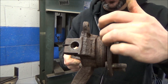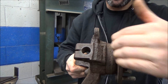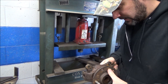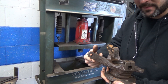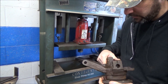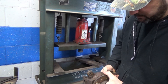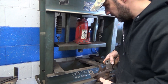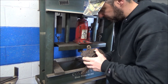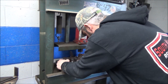Fortunately for us, it's got these little flats on the inside here. I think we'll be able to get our press blocks in there. If not, you can't go pressing on this piece here on the spindle where the tie rod hooks on, because this is cast iron — you'll just break it off. You can't really press on the two ears here where the brake caliper bracket would go, because you'll just break those off. So you're usually quite limited on what you can do.